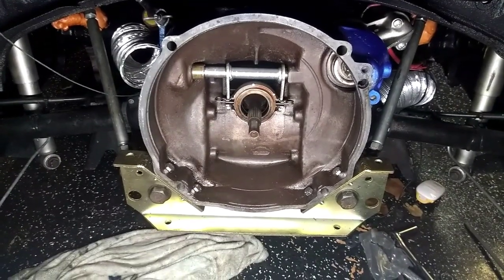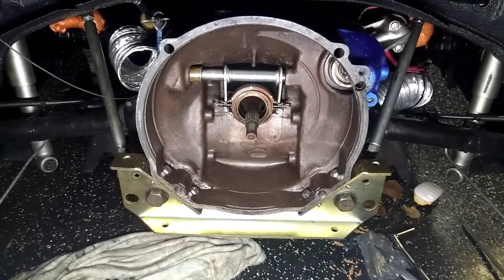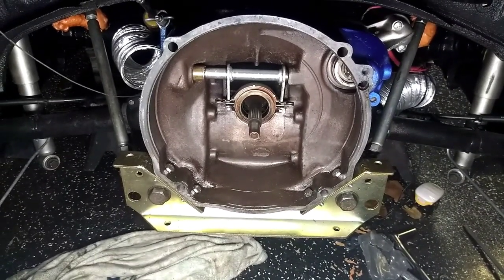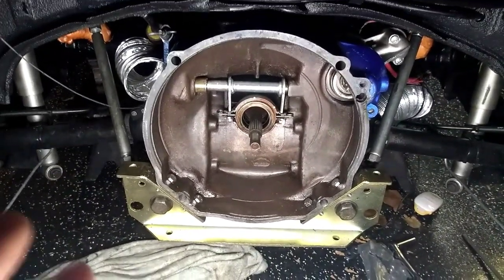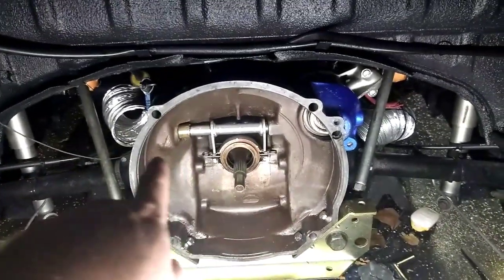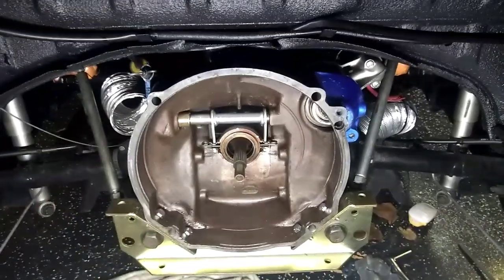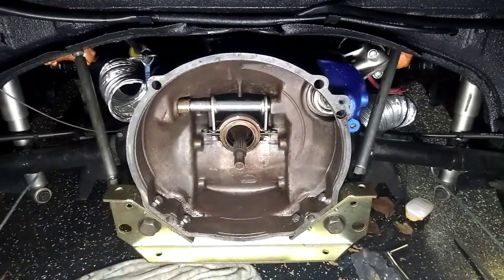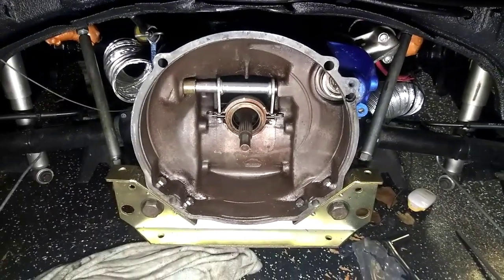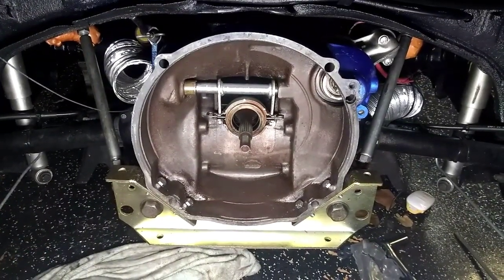You're going to experience probably sometimes, depending on how rough everything is on your car, some things may loosen up. So if there's any bolts, like on your transmission or anything like that, or on your mounts, because I had to use my stock German ones on the frame horn, on the actual nose cone mount, you'll have to go back every now and again and recheck those. Make sure they stay tight, because they will tend to loosen up.